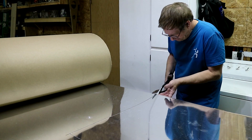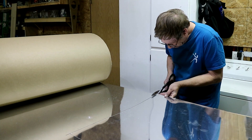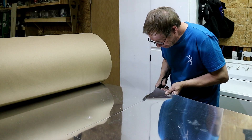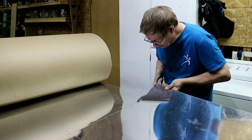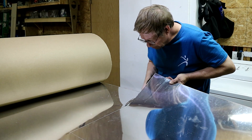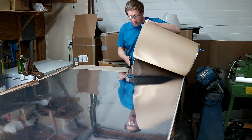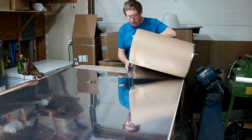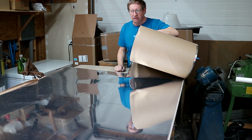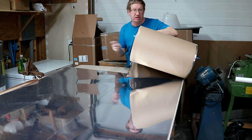I'm going to cut it. As I cut this length I'm going to keep rolling this up, because I made some long pieces of 20 thousandths for the stiffener that goes on the back of the aileron and the flap area — well, it goes on the back of the flap area.